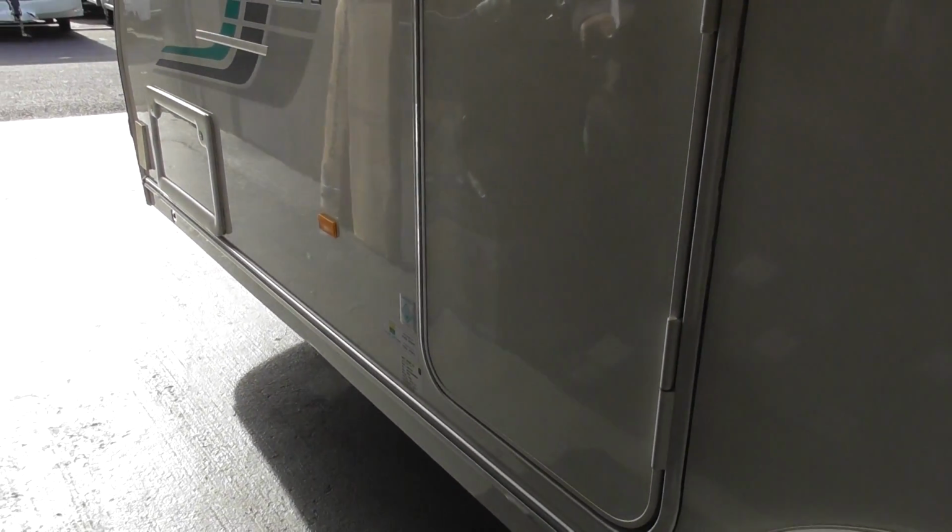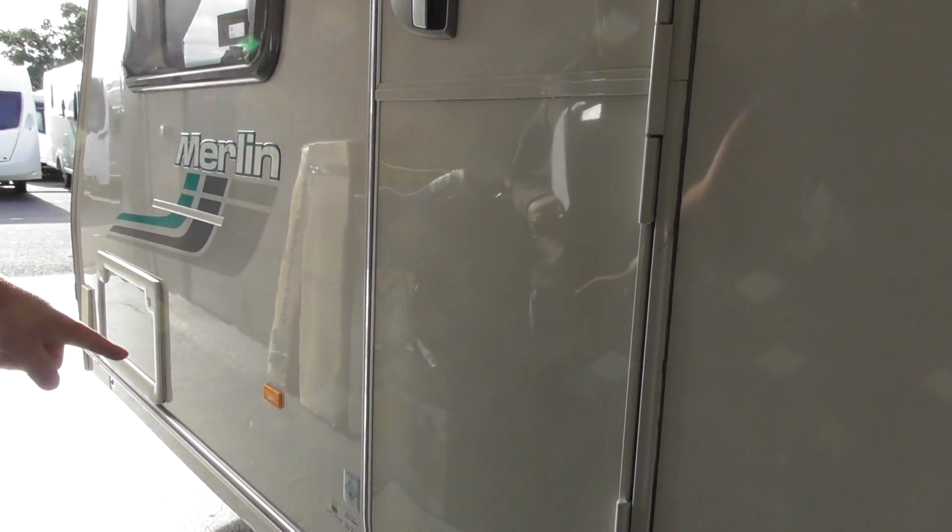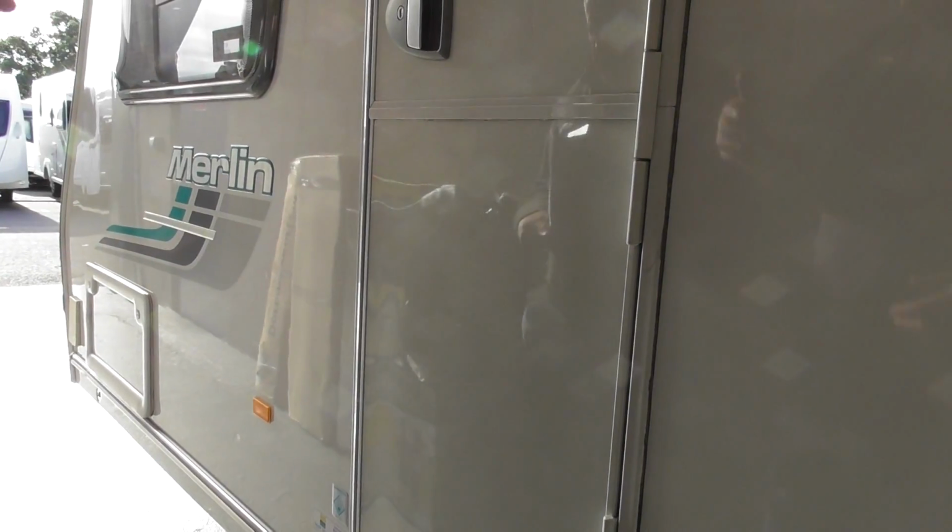So, tyres. 63 psi for your tyres. That's on the door here for you. And for the wheel nuts it's 115 newton meters. And is that written down anywhere? Yeah, that's in the book as well. The tyre pressure's on the door, and the newton meters is inside your manual. I'll show you your manual anyway.